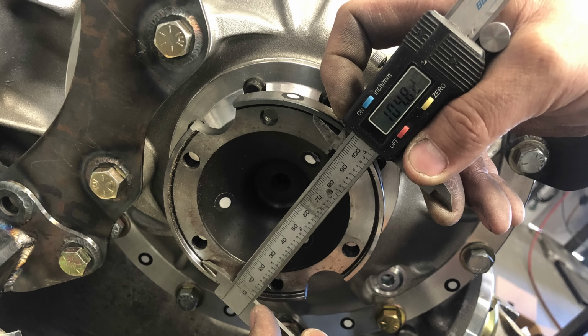But the world has some sort of irony and sense of humor. I got thrown another curveball. The 934 flanges on my Winters that are, say, 35 spline on them are actually 930s. They're 108 millimeters in diameter, and the 934s are much bigger. They're 128 mil, so 5-inch wide. And so I called Winters, and they're like, oh, we have no idea about that. So, Beaver, the owner of Winters, is going to be in Wednesday to hopefully help rectify the situation.